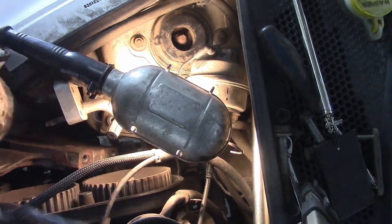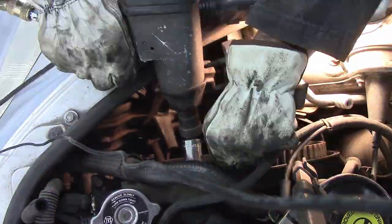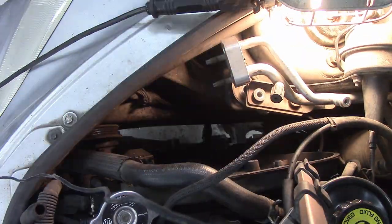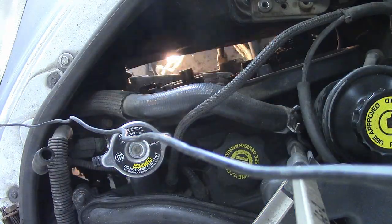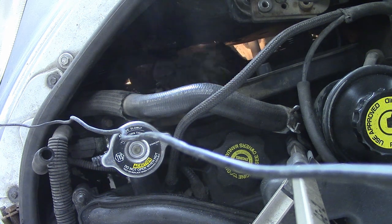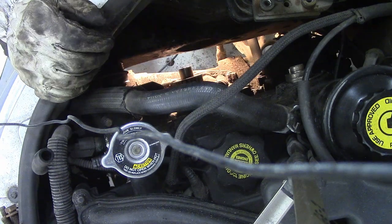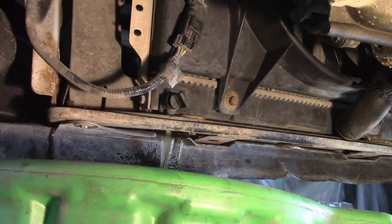As part of this endeavor, I ended up going out and buying a whole new set of ratchet wrenches that are thinner than the ones I have. I've been using the same ratchets since the 80s — they work okay, but the technology has improved and prices have come down. Still, my hands don't fit, my fingers don't bend, my wrists can't do it. This job needs to go to a younger person. It looks like I'm trying to remove the back cover of the timing belt, which makes it easier to get at the cam seals and pull the water pump off. Draining the coolant because the water pump has to come off.